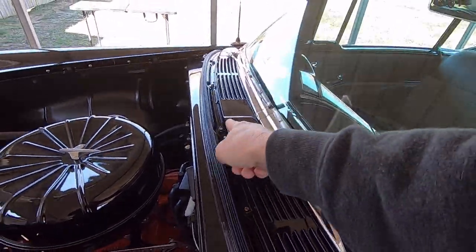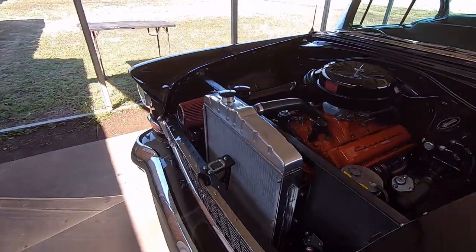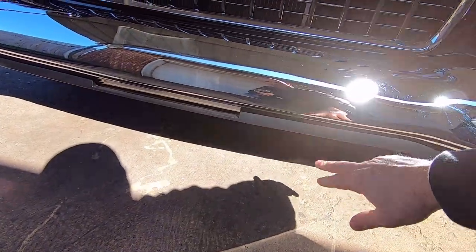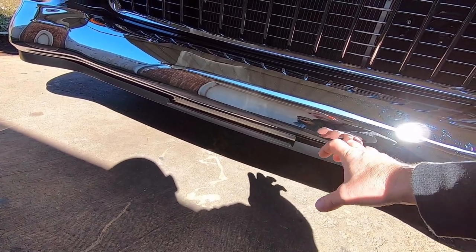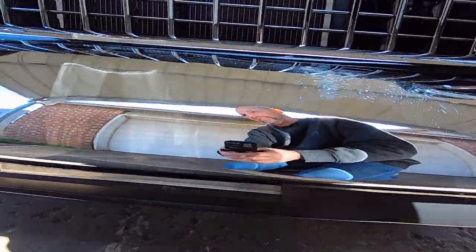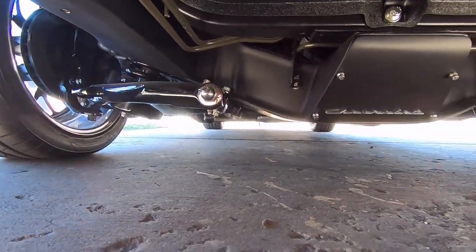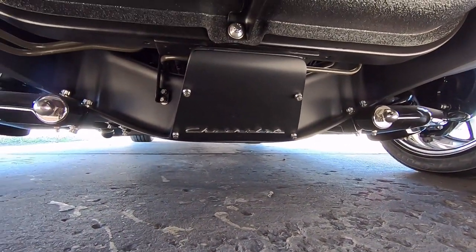Part of the hood has a louver section so the hood peak goes all the way to the windshield instead of just the hood. I made a lower air dam from an original front bumper — I sectioned it, cut it to pieces, welded it all together, and plated it in so it looks like a mail slot. That opening is access for the air intake for the transmission cooler. Underneath you can really see all the chassis work and smoothing of the A-arms.